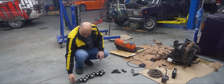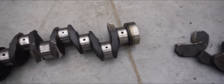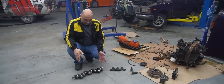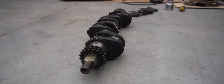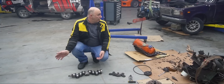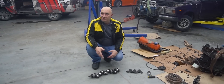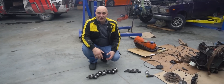Okay, so here's where we're at. We're looking at a crankshaft that's lost quite a bit of weight. Right here you can see the webbing that we cut off — it's still pretty hot. We didn't mask anything before we started hacking, so now it's a matter of giving it a good clean. We've got all we need, including some cleaners and compressed air to dry it off. Then we settle it right back in, attach the caps, rods, everything else. Throw that motor into the car, start it, and wonder what'll happen. I'm guessing it should be able to rev up quicker with the crankshaft being so light.